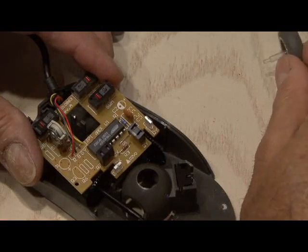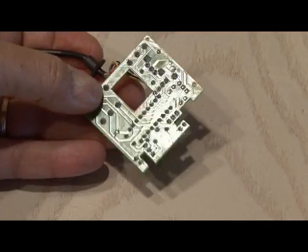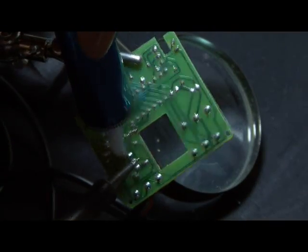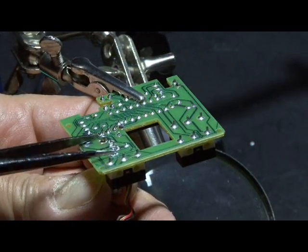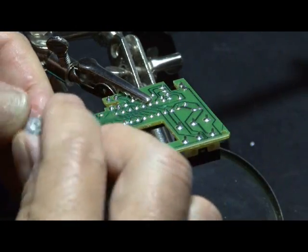Remove the scroll wheel and remove the circuit board from the mouse body. We're going to relocate the rotary encoder, so it must be removed from the circuit board. There are three contacts, and also usually a couple of soldered-in mounts for the rotary encoder. So we'll desolder those contacts and remove the rotary encoder from the mouse circuit board.